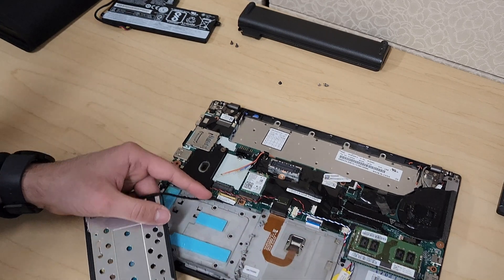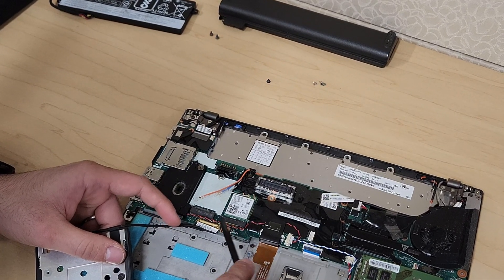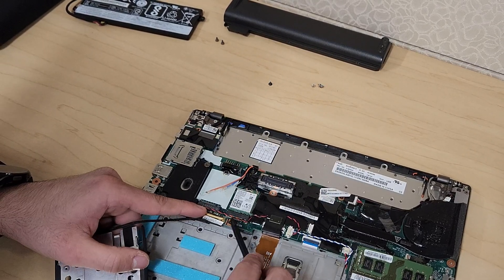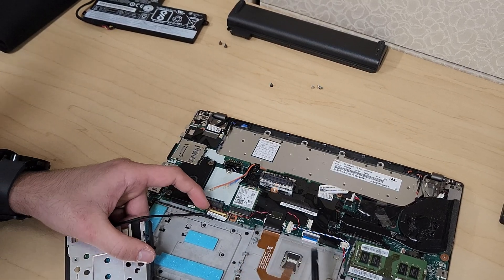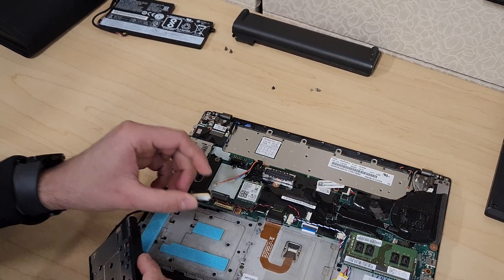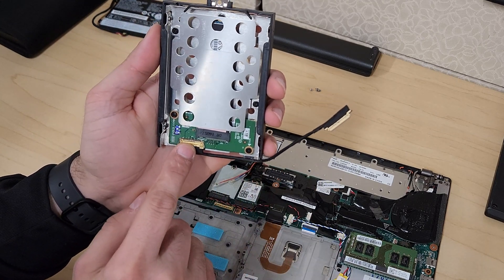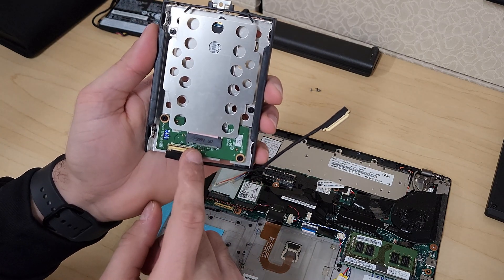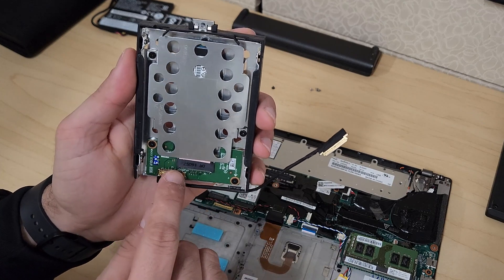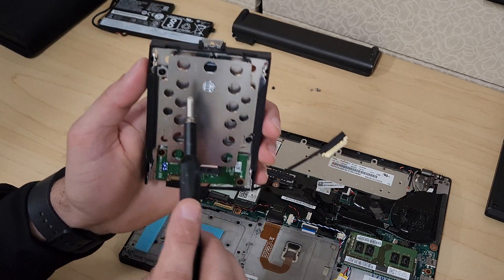You still have to remove the connection here. If you have nails you can use that, but you may need to move this cable a little bit out of the way — that's for the speaker. There's a little metal bracket that just came out like so, then just wiggle this a little bit left and right and it'll come out. If you flip this over there's another connection on this side — same thing, remove the bracket and pull the connection out.